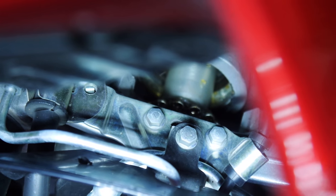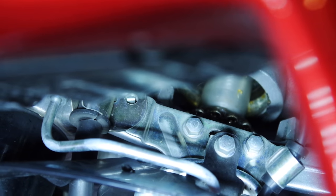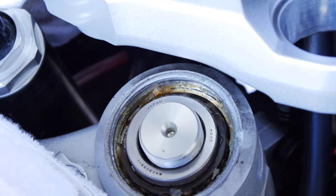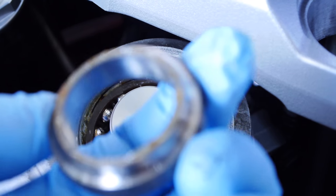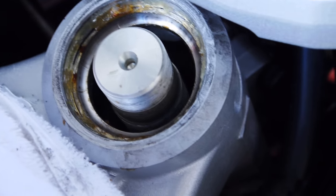You'd probably also be feeling any issues at this point in the steering. This particular bike steers like brand new so I don't see or expect anything unusual. Everything's good. Now we're going to take off the top plate, move it out of the way, and carefully check the inner portion for any scratches, and check out the bearing, races, and balls. Everything looks good — just needs some new grease.